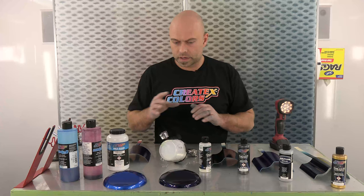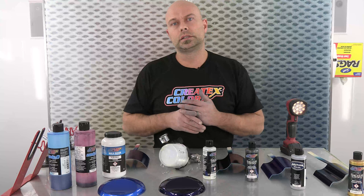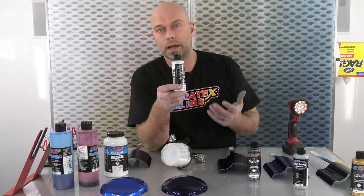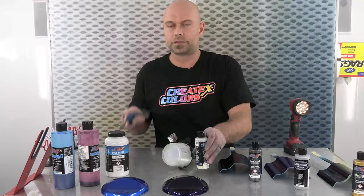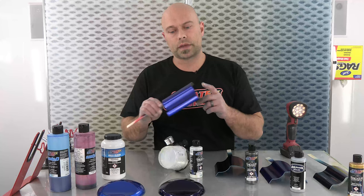Something you can do to kick this color up in terms of a really cool effect — we just released six new Wicked Flare colors this year. We're going to talk about color keying a flare color. For instance, this is our Wicked Flare Blue-Violet, which has a blue-violet flip. We're going to do a coat or two of this over the top. I have the blue sample I showed earlier in the video — same exact blue as what we sprayed — and I'm going to take that one and put a couple coats of that Flare Blue-Violet over it so we can see the difference.